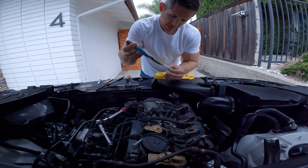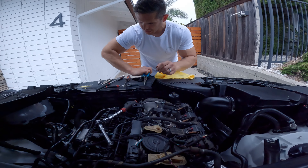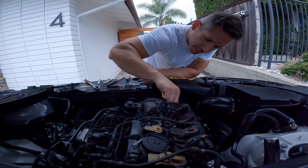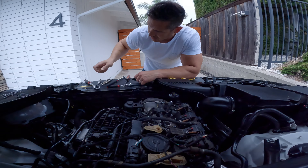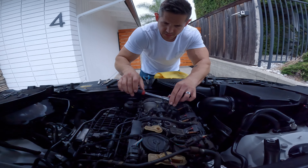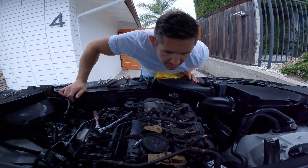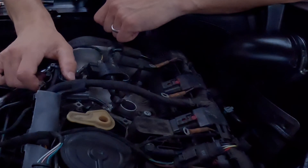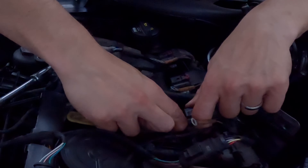There's our new one. I'm going to slide that in ever so slowly. I don't want to just drop it in. If I had the correct spark plug socket, this wouldn't be an issue, but the hole's so deep I can't actually get it in there without dropping it. I'll lower it in, get our six-inch extension, and be just ever so gentle getting this in there. Just enough to crush that washer a little bit. Okay, that's one successfully done.